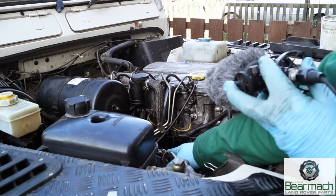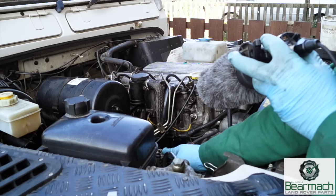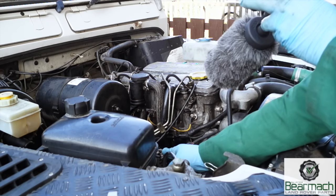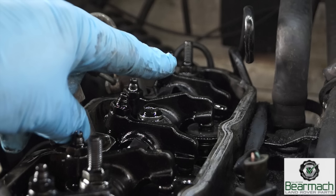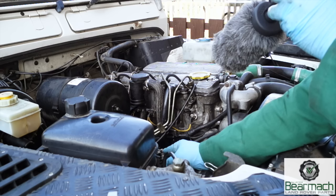I've shown you a few things, and basically changing the injectors for good test ones that I have in my possession — the combustion knock has actually gone. However, if you listen carefully you'll hear a rattling, which is the fuel lift pump or suspected to be the fuel lift pump. In part one of this engine condition checking, we did do a compression test to find that the cylinders are even. This doesn't mean to say that we aren't having piston ring problems. However, what we're suspecting is the valves are worn and so are the stem seals, letting oil be drawn into cylinders three and four. The only way we're going to find this out is to actually intrusively strip the engine down and measure things. But first, we're going to check the turbo pressure and a few other things before we go ahead and do some serious overhauling.